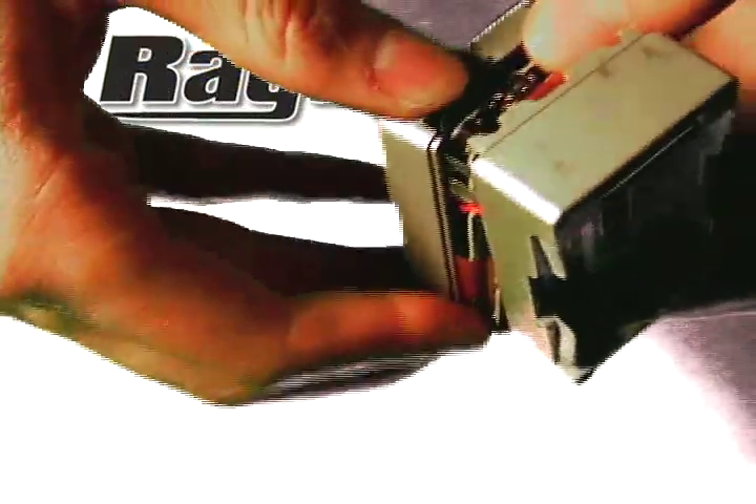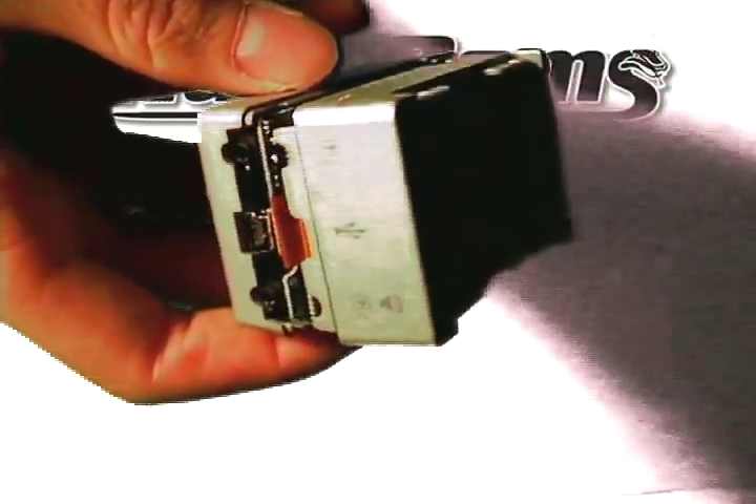It's mandatory to make sure the lens goes in evenly. If it starts to off-thread and the lens is not perfectly straight, you have to de-thread it and put it back in. Usually there are no problems, but occasionally we run into cameras where GoPro glued it so badly that the threads are a little bit messed up.